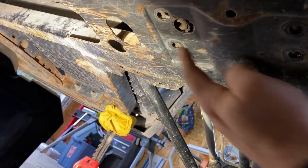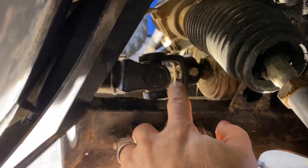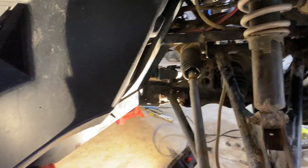The last thing — you don't need to remove the front diff, but you do need to unbolt it. Those two bolts there and those two bolts there. That gives you just enough room to slide the front diff around, which allows you to slip the slip yoke on at the very back at the engine, then slide the front U-joint onto the splines. Just make sure you line up the hole with that roll pin and you're set to go.